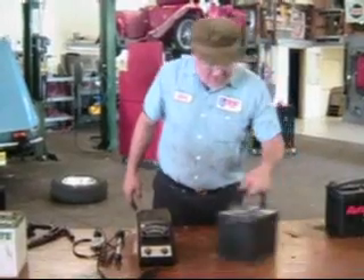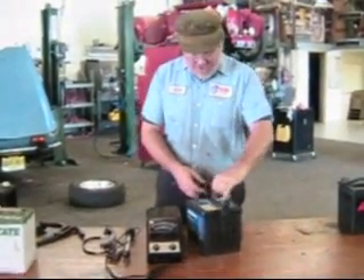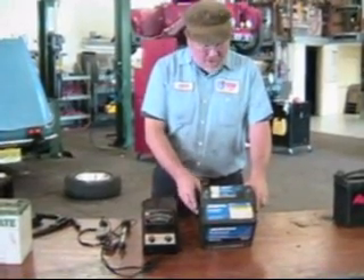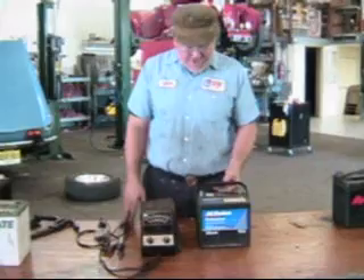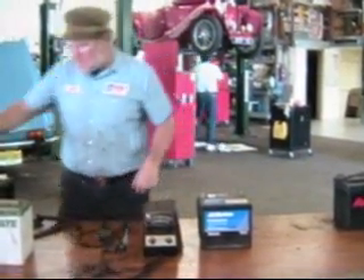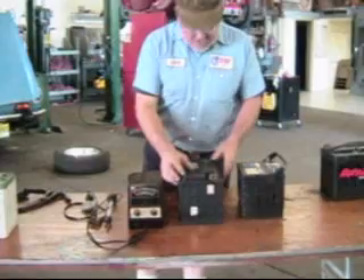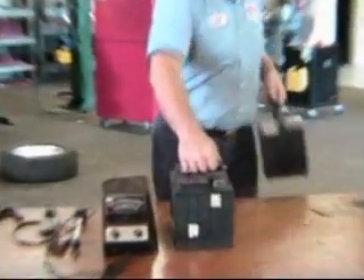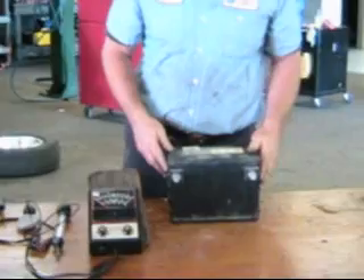Some of the batteries we get are maintenance-free batteries. They've got posts on the top, but you can't get inside them, so how do you know if they're any good? These manufacturers are just making a bet that you're going to own the car for less time than you own the battery. There's no way to service these. A certain amount of electrolyte is lost every time it's charged, so eventually they run out of water. 'Maintenance free' just means you cannot service it — doesn't mean it doesn't have to be serviced. There's also the side-post battery, and there's no point in having one in an MG because all they do is hit the side of the battery box, dead-short, and burn up your car.